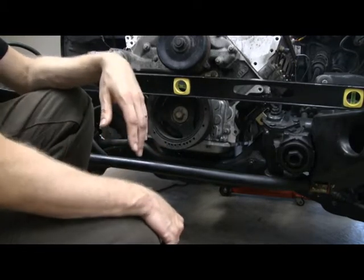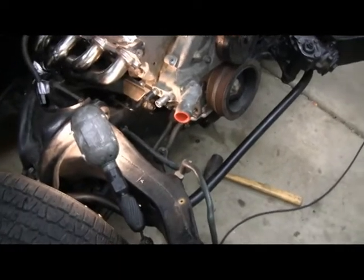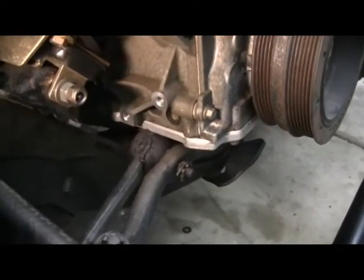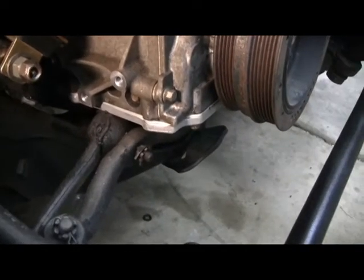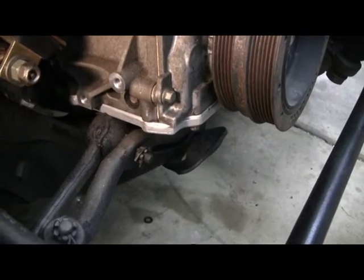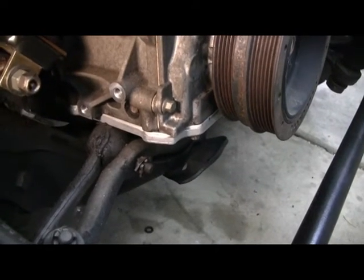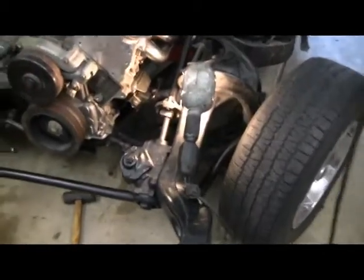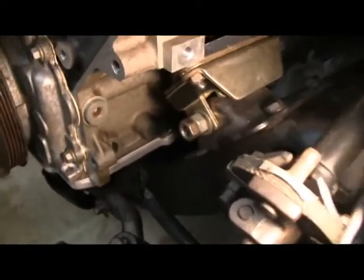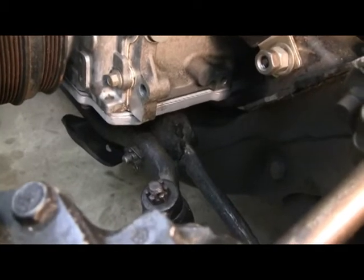The other thing I'm going to check is the steering linkage because it was hitting the old pan. I'm wondering now when you go lock to lock if it clears with the new pan. It doesn't — you can see there it still hits. I'm wondering if there's a big lip on that pan I could just grind down in that area and it would maybe clear, since it's just hitting the lip. If not it's no worse than what it was before. Let's try the wheel steered the other way. And look at that — it clears! See that — it goes right under the pan. It clears everything. Really nice.